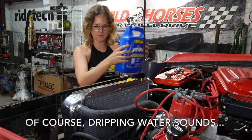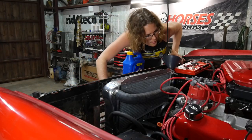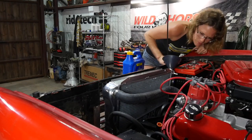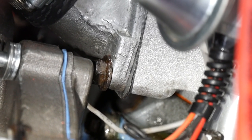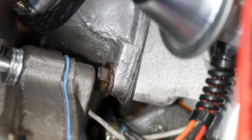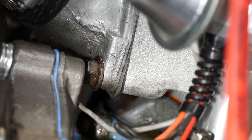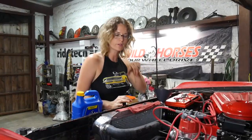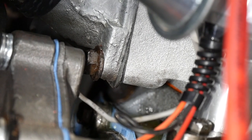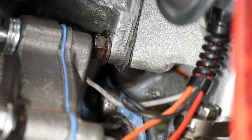Where is that coming from? I see it — it's gathering on the water pump. Something's going on there. New gasket. It could be that those bolts are just a tiny bit too long, but they're the ones that came out of the old one, so I wouldn't think they'd be too long. Let's pull it off, check the surfaces, and drain at least some of the coolant. A little thermostat housing — let's start over.